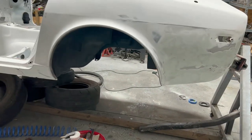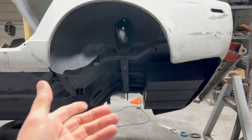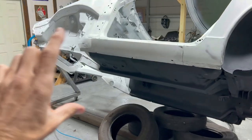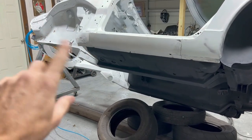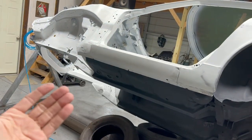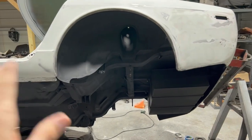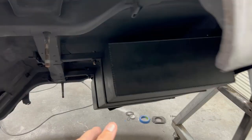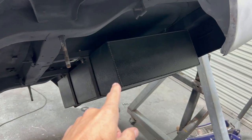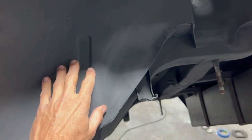The complete underside of the car — let me flip it up. Got it flipped up and I wanted to show you guys under the car. Got most of it undercoated. I'm still not done up here — I need to undercoat up into the wheel wells and under the frame rail, pretty much anywhere a rock can hit it. So anywhere a rock could possibly hit your car, you want it undercoated.